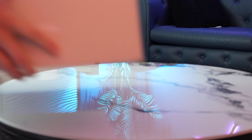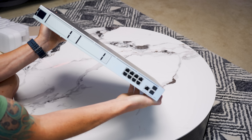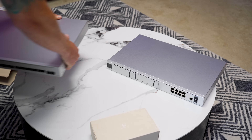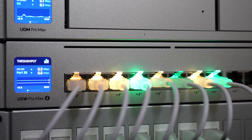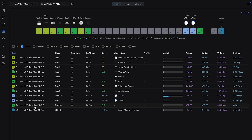I decided to go all in. I wanted my network setup to work for me for years to come, so I got the UniFi Dream Machine Pro Max — this is my UniFi Cloud Gateway, also known as my router. This router does not include PoE ports or built-in Wi-Fi, so I needed to order a PoE switch as well as some Wi-Fi access points. I ordered the new Pro Max 24-port PoE switch and two of their U7 Pro Wi-Fi access points. These access points connect to the router via Power over Ethernet through the 24-port switch. All this UniFi gear totaled about $1,800 for me.